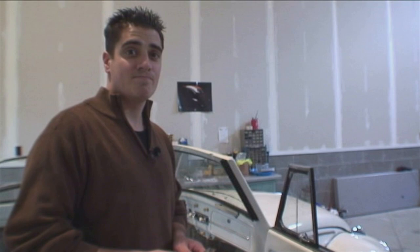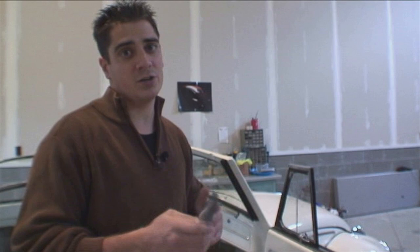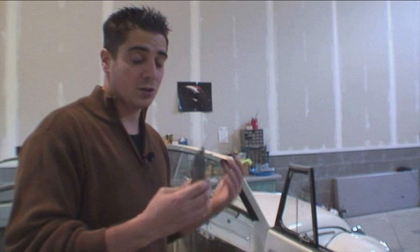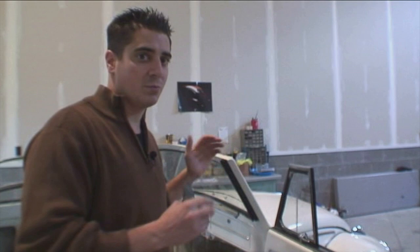The next step is to take your windows out of the car — you have to take the windows out to successfully install your headliner. There are two ways to do it. If you want to save your seals, you can push the window out carefully and you should do it with a partner. The other way — the easy way — is to just cut the seal. If the seals are bad or dry-rotted and you want to do a seal restoration, just cut the inside lip of the seal and the window will come out nice and easy. I'll show you on this convertible because it's easier to film — once you can pop the front windshield out you can pop all the other windows out the same way.